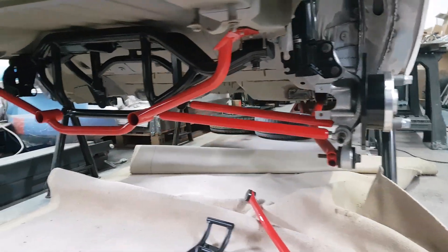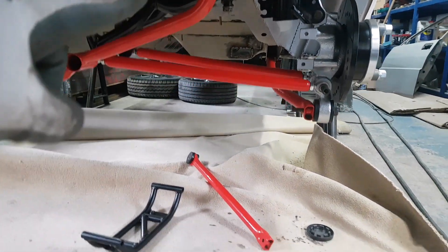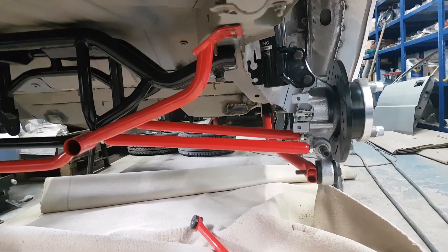The other thing you're going to want to have a closer look at is the rear suspension and the diff cradle. Ride Walkers have done the cradle up in York — it's a nice bit of engineering and does give you a bit of extra space, so when you're putting the exhaust on you've got a little bit more room. And of course I couldn't put the original housing on after I'd spent all the time making those lovely rose-jointed suspension arms. You can see on this side there's a decent area for getting the exhaust through.